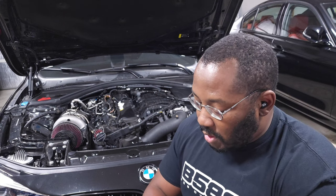It's still a German car, so water pump issues are inevitable to some degree. That said, Gen 1 B58 water pumps are extremely reliable overall. For Gen 2 owners, just make sure you don't have the older water pump — get it updated if you do — and then you should be able to enjoy your car for a very long time.